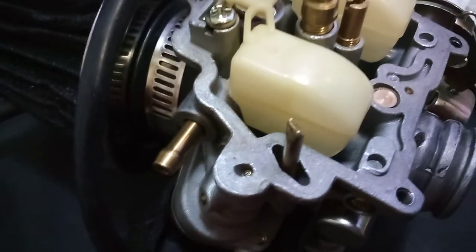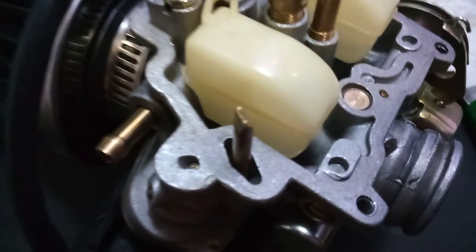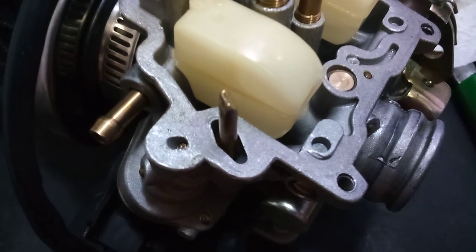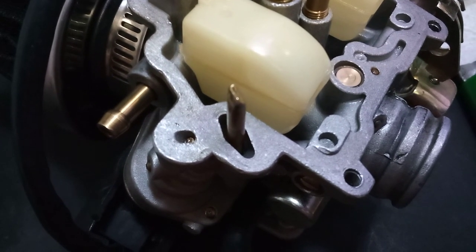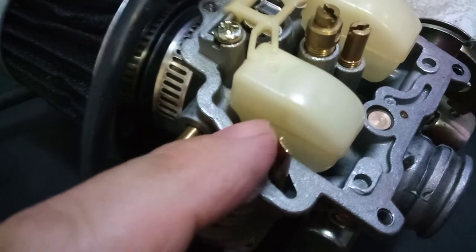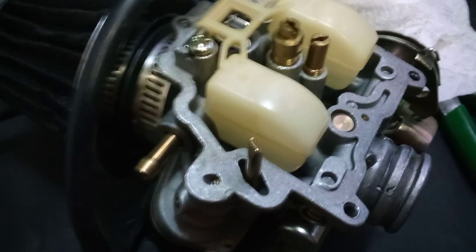I'm just making this video to share it with others. If you have a better idea on how to control the RPM during startup, let me know. I noticed a lot of people are trying to put manual chokes in there, but if your scooter is encased in plastic like a lot of the Chinese ones are, you can't even get a hand down in there. Trying to use the enricher the way it was supposed to and having some means of adjusting the RPM — like this right here — might be the way to go. Thank you for watching.